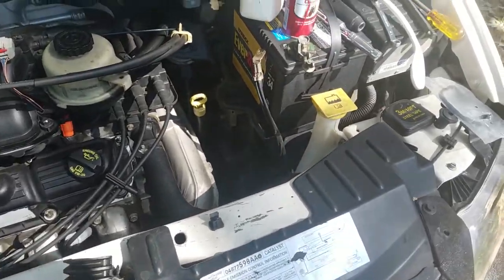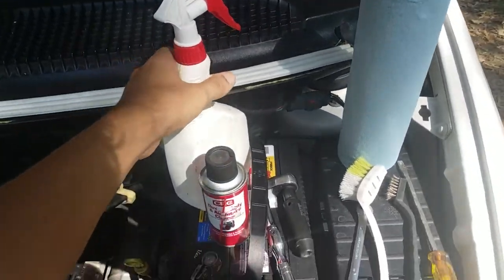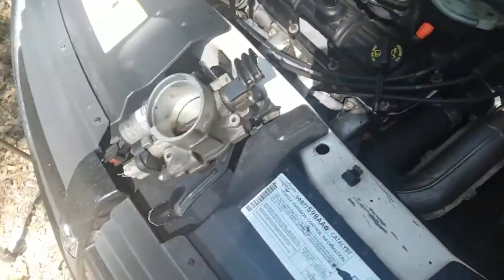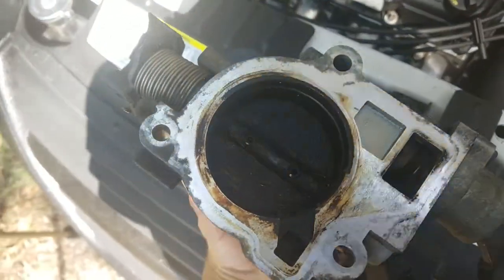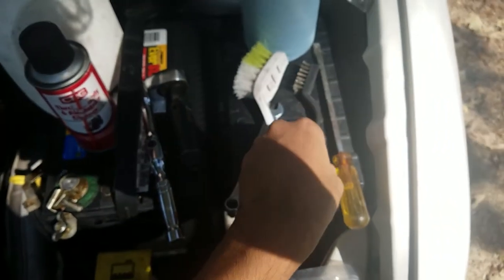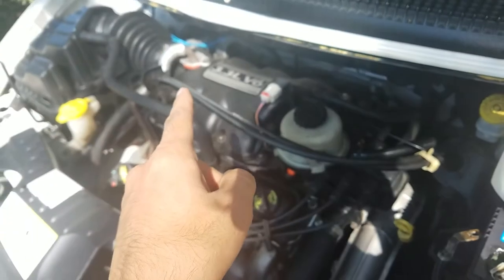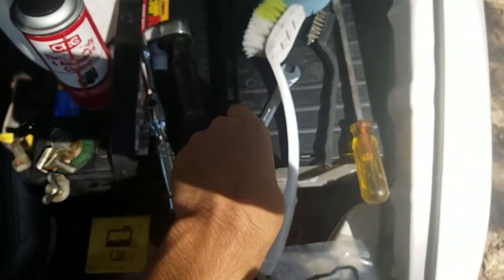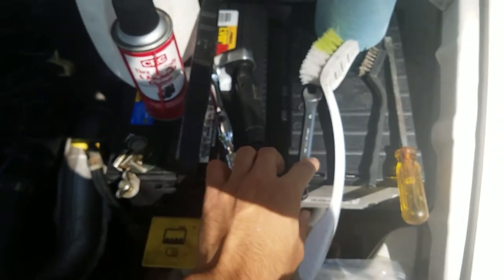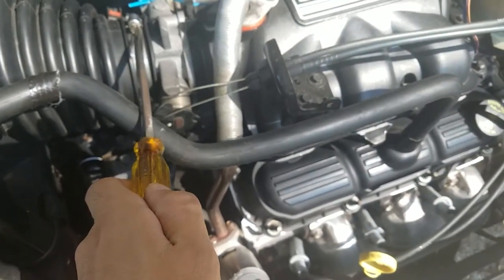To get this job done is very simple. You'll only need a couple simple tools. You'll need some dish soap and some throttle body cleaner, because we want to clean out the carbon deposits that are on this used throttle body. To clean that, you're also going to need some scrubbers — I got that kind and a metal wire brush. To take off the old throttle body and install the new one, you'll need a 10mm wrench and socket, and a flathead screwdriver or an 8mm to take off the hose clamps.